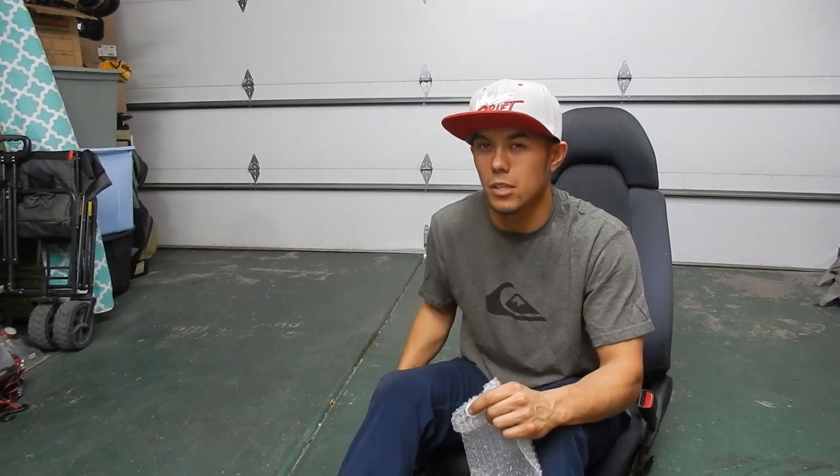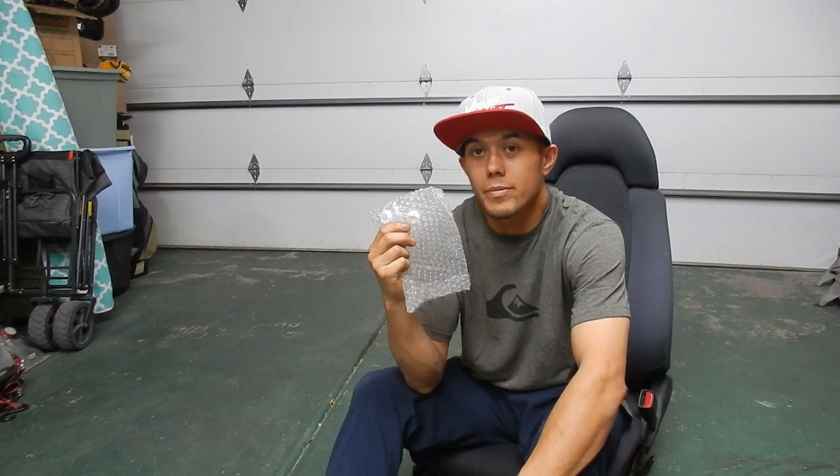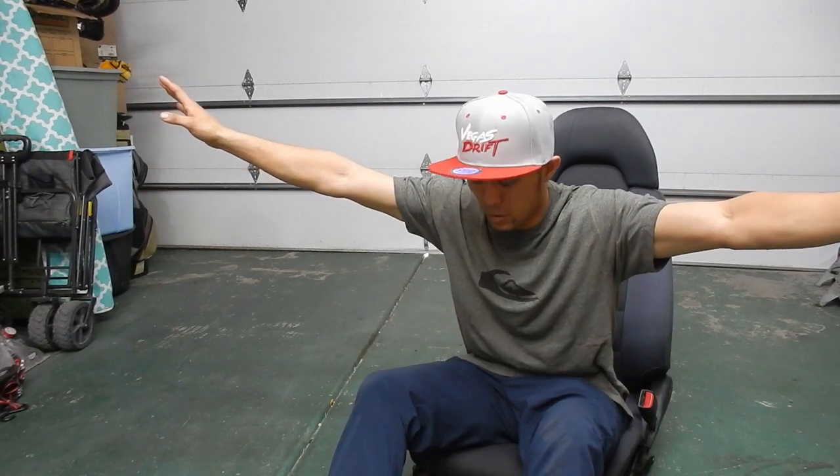The first time I only did one side, which was short-lived. I replaced one gear but not the other right away - it worked briefly then stopped. The metal threads shredded into the plastic ones. Now I'm replacing both at the same time. If this doesn't work, I'm throwing in the towel and these seats won't be moved, which would suck.